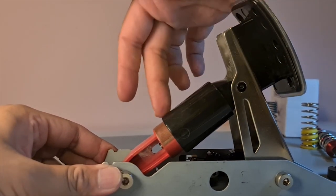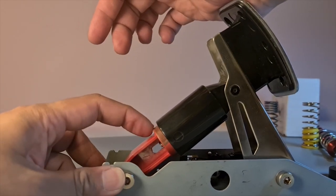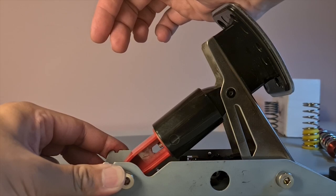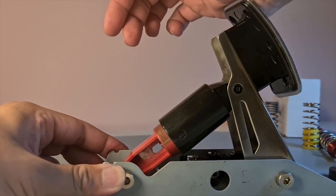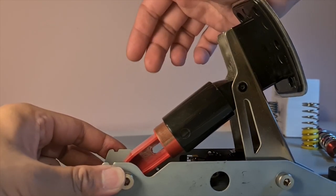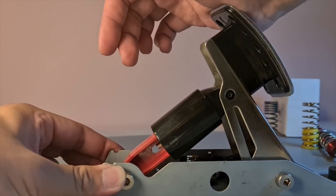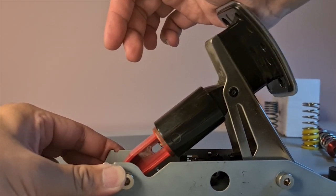I'm not sure if it's exactly 80%, 75%, or 90%, but you can adjust this gap with the washers — fewer washers and it stops sooner, more washers and it stops later. It's up to you where you want it; for me this works fine. It goes to 80%, you can hammer the brake a bit more, then ease off.